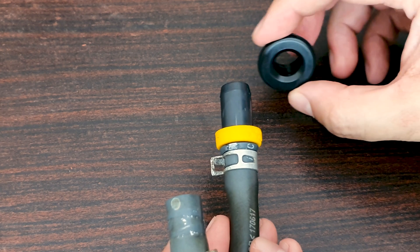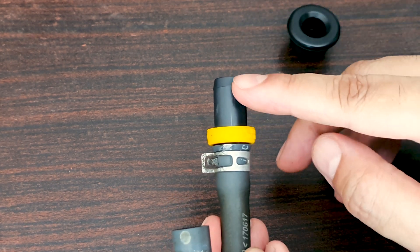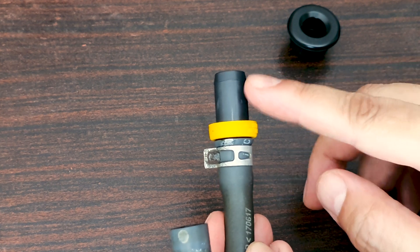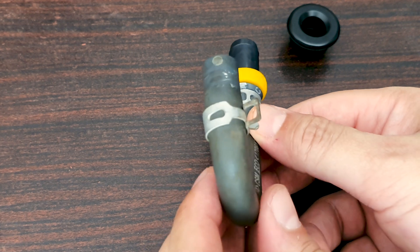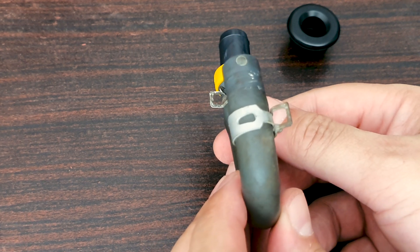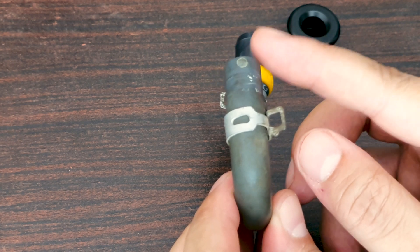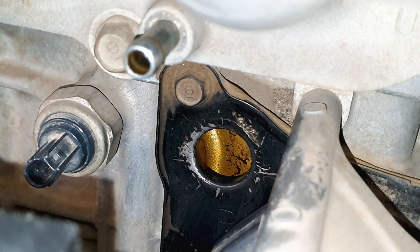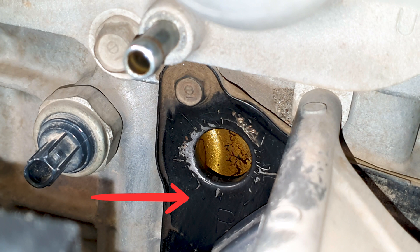The plan of attack is to install this grommet first, then I will apply a little bit of silicone grease on the edge to make it easier to put in because this will be a tight fit. When you install it, try to keep it as straight as possible, slightly towards the left, because the top hose is slightly offset towards the left side. I soaked a cloth with degreaser and cleaned the area up. Obviously you don't want to spray anything that may go inside. This black plate separates the oil from the vapor or gases — in a way, you can say this is a stock catch can.